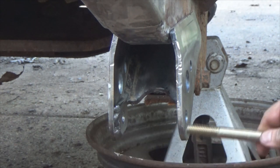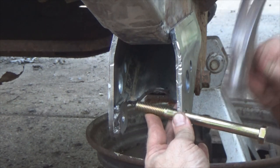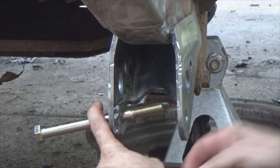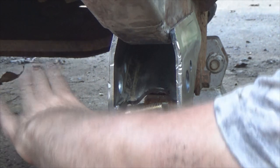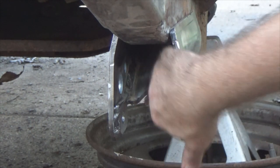Once you get to depth on the frame, you can take your bolt — being heavy right here — if you want to rock it down this way, put your bolt there, take a hammer, lightly tap it, and it'll rock it down that way. Or if you want it to tilt down the other way, come in this side, hold up on this so it doesn't rattle, and tap it right here — it'll bring it down this way. Just don't get a really crazy hit with a hammer because you can easily knock it right back off the frame.